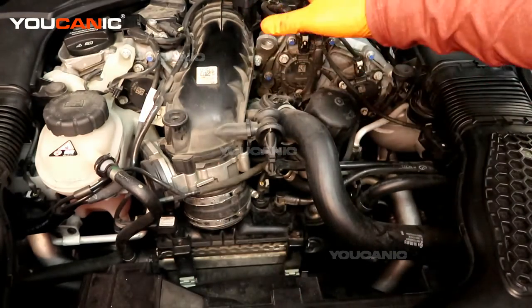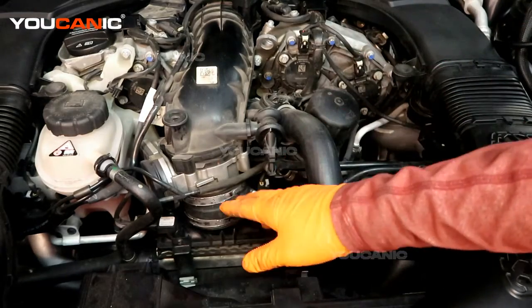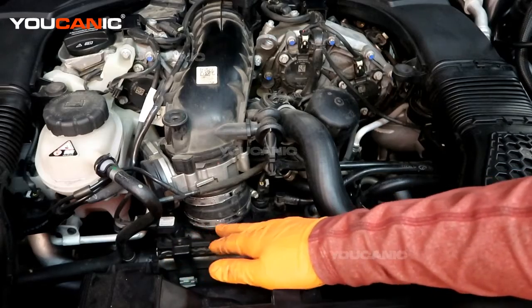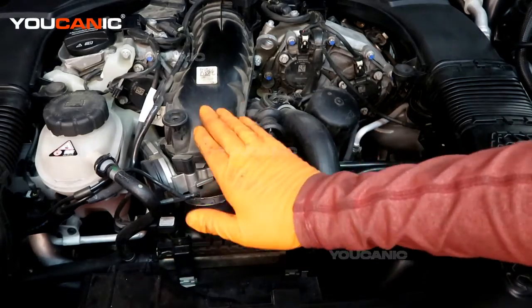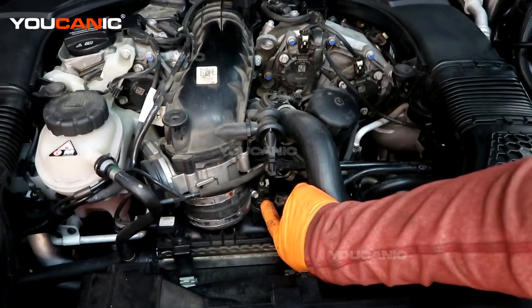You would have a little cover over here, part of your intake cover that sits up and covers the engine, so you'd pop that off. Then we get down into here where this is the charge cooler, the throttle body intake system, and the intake tube that goes into the engine. We're looking for the sensor that is right down here.